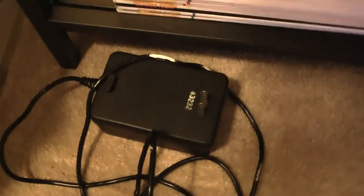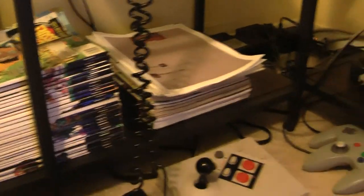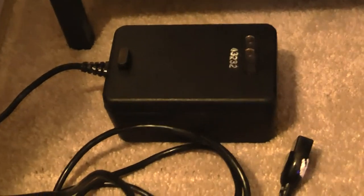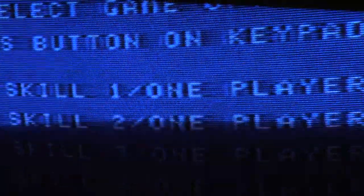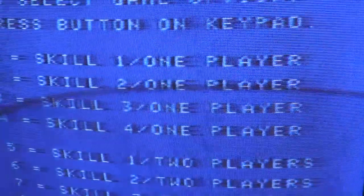The only thing that was wrong with this unit was the adapter - the styrofoam kind of melted with it. On pin 1 it was only outputting about 1.6 volts. This would power up and give a blank screen. I got another one off eBay and I'm gonna dissect this one to see what the hell failed in it. Fine tuning controls - if your TV is so equipped, it may be digitally tuned but there is fine tuning. I actually did something there and made it black and white. To go to automatic fine tuning again, you go to channel 03.